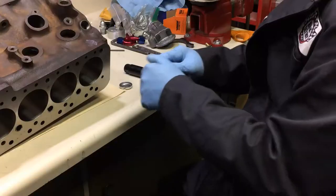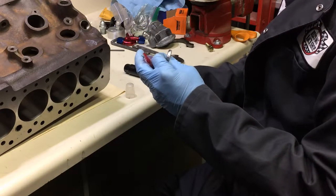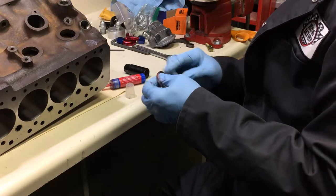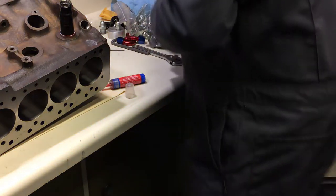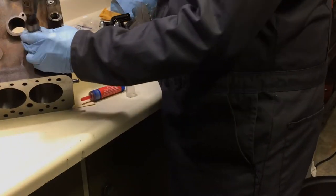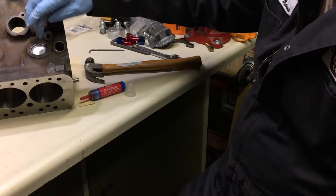Now we'll do the freeze plugs. For these, I'm adding a little bit of thread sealant. I know there's several different philosophies behind these. I want to make sure that they're in there pretty good and solid. Some people use JB Weld. Some people use other things. Research what's possible, and then decide for yourself what you want to use. Okay, if you've never done these, try to get them in as straight as you can, slightly below the surface there.